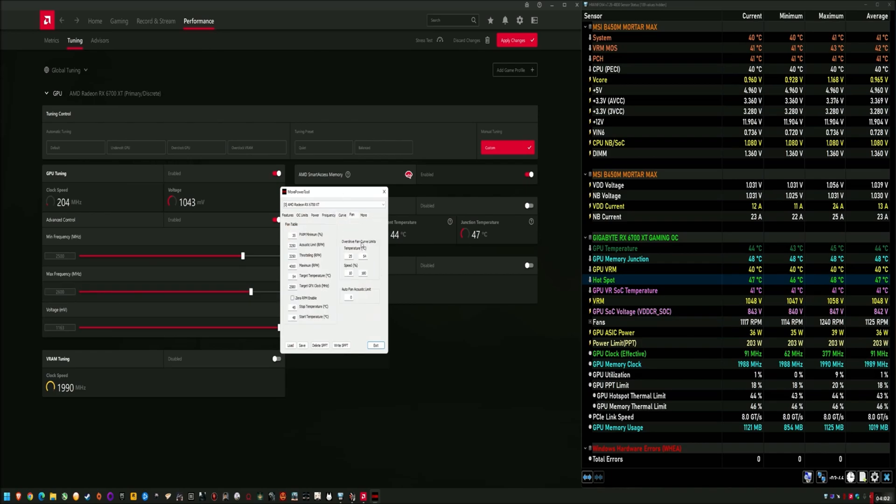My goal is just good hotspot temps. My RPM temp target is set to 58 degrees, and that's because I noticed the fans always spin up late. I don't know if it's a driver latency issue, but using external programs doesn't help because it conflicts with Radeon software. When I try to set a curve aiming at keeping the junction temp down, they spin up late — it almost seems like the curve either reacts late or it's going off the edge temp. So if your goal is better junction temps, you can't set a temp target based on edge temp — you've got to set it lower based on the core temperature.